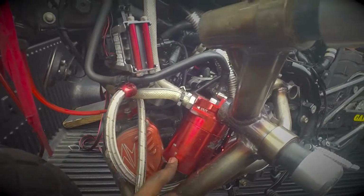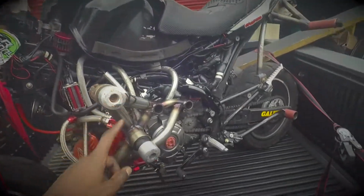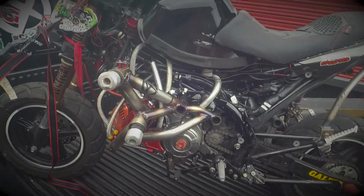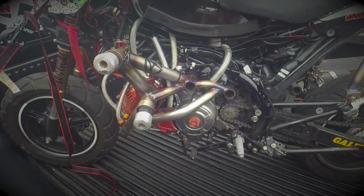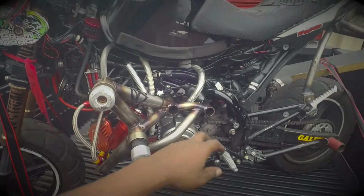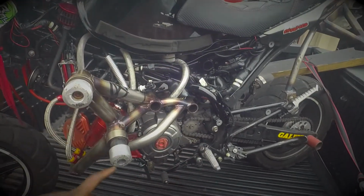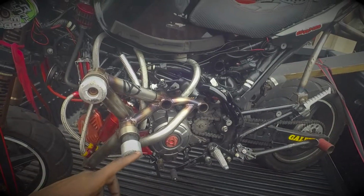And the only time I've noticed now that I even get oil in the side is if I dump it and it falls on the left-hand side, and since the breather's on this side, and I let it sit for a minute as I'm recovering from dumping it, and it's still running, it just starts to push oil out this side. That was the number one time I would notice I would spill oil all over the ground, if I crash like that.